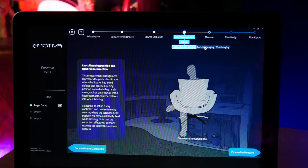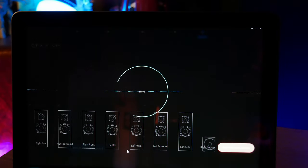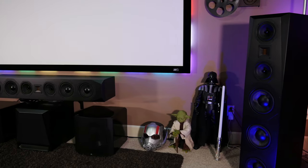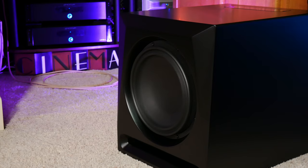Once that was done, the process of calibrating our system was actually pretty straightforward using the Dirac Live software. After doing a basic level calibration, we went with a normal width EQ configuration, which meant measuring 13 different points around our listening position — this took about half an hour. Once the measurements were done, we uploaded our new reference curve to the processor and disconnected the Dirac Live kit. The new Dirac settings were automatically applied and we started retesting our movies. I usually don't expect a whole lot from automatic room correction, but I was really surprised how much of a noticeable impact Dirac had. It really cleaned up the sound in our room and revealed some new sounds I hadn't noticed before. By far the biggest difference was the bass — since the processor has control over three separate subwoofer outputs, the Dirac profile was able to tweak the subs more precisely, while still being really tight and impactful.